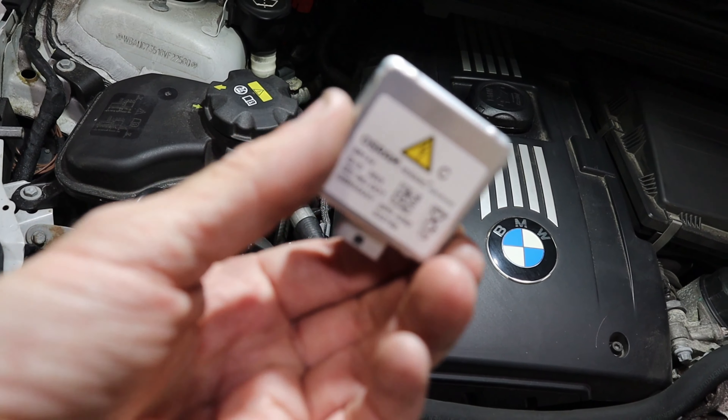It's highly recommended that you disconnect the battery when working on Xenon headlights because this is high voltage. That is the factory recommendation. Personally, I don't disconnect the battery because you have to check every time you swap a component by turning the headlights back on, and constantly disconnecting and reconnecting the battery can cause other damage to the car. So I just make sure the key is out of the ignition and the headlights are turned off so there's no power going to the headlights while I'm working on them.